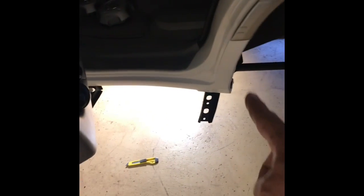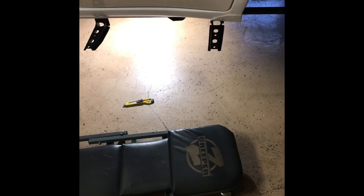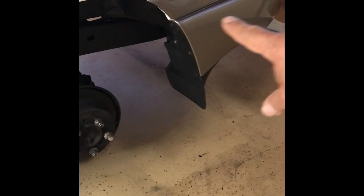I found the exact color of the truck in an aerosol can, so it's just been a rattle-can kind of project. I did the same thing on all four doors and did the whole underside of this rocker. Then I did this repair I showed you previously where that little area was compromised — I had to rebuild it. I didn't want to cut, mold, and put Bondo, so I just put a cover on it with some rivets, just like I did the rear section in that other video. I rebuilt this whole little area and did the whole rocker panel underneath.